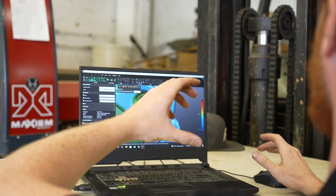Using the scan data we collected, we were able to generate an entity file — basically a step file of all the important parts of the knuckle: holes, tapers, planes, flat surfaces like where the brakes mount or the bearing mounts, and so forth. We're able to use those points and overlay them with a mesh file, which is basically the shape and structure of the entire knuckle. You can't make a solid out of the full knuckle in the computer because there's so much data in that mesh.